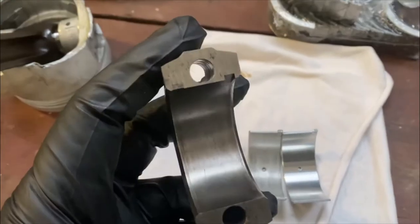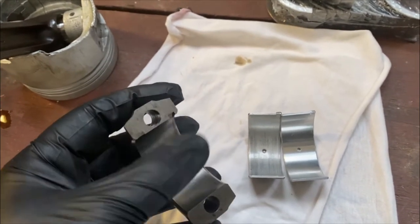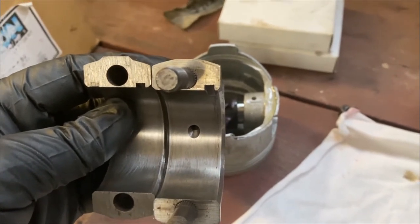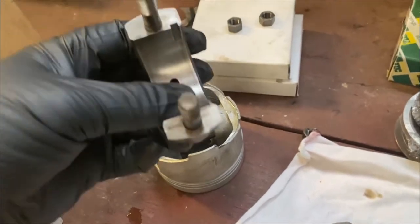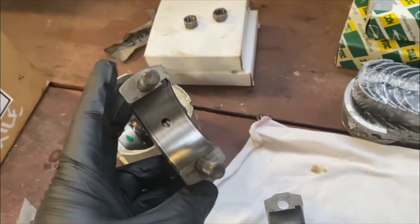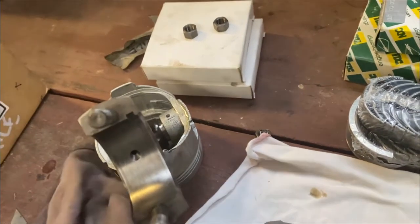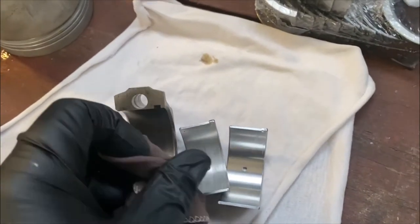You'll be able to see the engineering workshop checked and measured all the sizes, but they do give it a nice light linish to make sure there's no rust and no high points, so that it's perfectly flat and goes back together onto the rod properly. It's always worth, before you start fitting bearings, just to give it a feel yourself, make sure there's no raised bits or edges or gouges. Give everything a good wipe down. Make sure there's no lumps of dirt and grease, because even the tiniest little lump of dirt or grease could change your crush on your bearings.